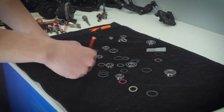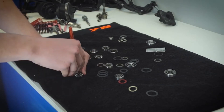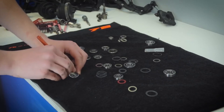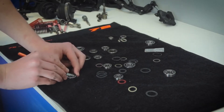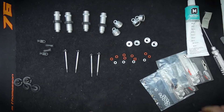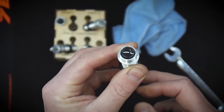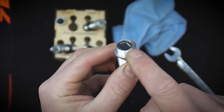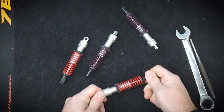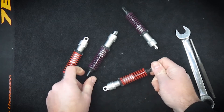Why do you need the old bearings? To get the dirt out from behind them. You're picking at that like an old chook out in the chook pen! Any lateral movement in the bearing means it needs to be tossed. Let's get these shocks buttoned up — they feel so much better. I have my pistons at the bottom of the stroke. If you guys haven't rebuilt your shocks in a while, you need to get to it, because they feel absolutely amazing.